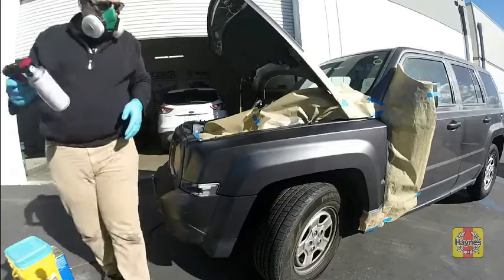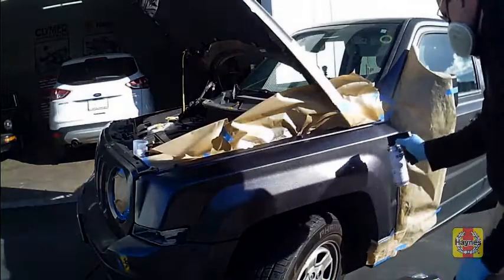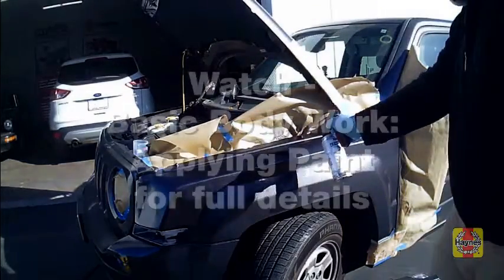In modern paint, the gloss and UV protection are all in the clear top coat. A recent innovation is professional quality activated 2K clear coat in a spray can. Like all 2K paints, you need to wear a respirator and should cover any bare skin when spraying.